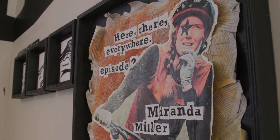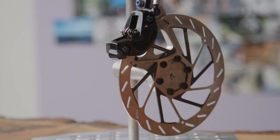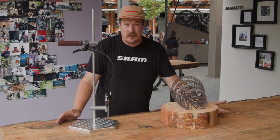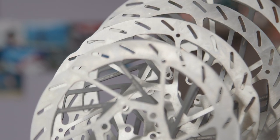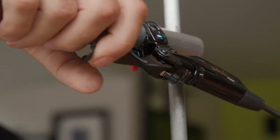In addition to athlete support and some of the creative stuff we're doing, we're talking brakes — how to tune them, how to make them work better for you. Before you even get out on the trails, one of the most important things you can do is ensure that you have a proper brake setup. Some people want more power, some people want longevity and reliability — all these things can be adjusted through rotor size, pads, and the way that you set up the controls on your lever.